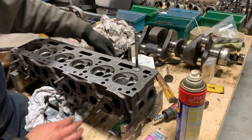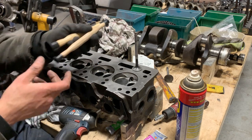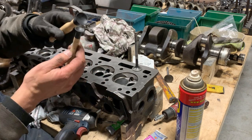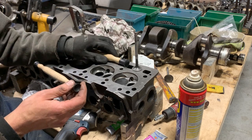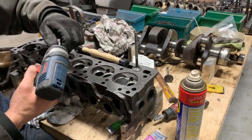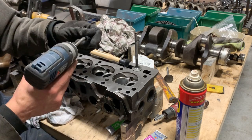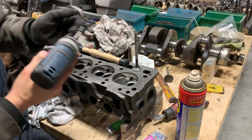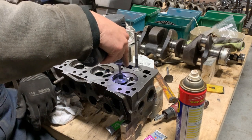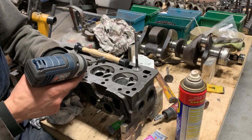Just wanted to show you something: there are four different suction cups here for different valve sizes. In general I use the second and third by size. If you have a lot to grind, you can pull the suction cup off and use one of these adapters — for the small one you can use the quarter-inch adapter, put it in your drill, and spin your valve with it.